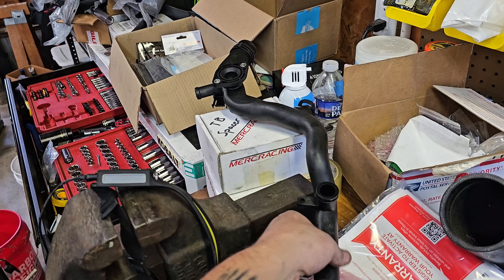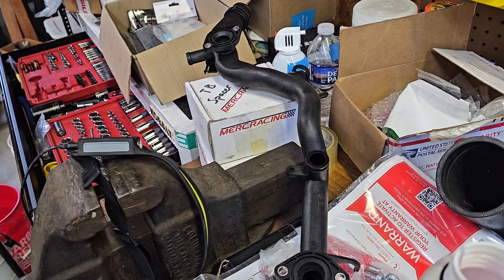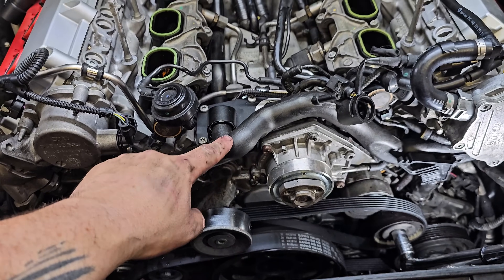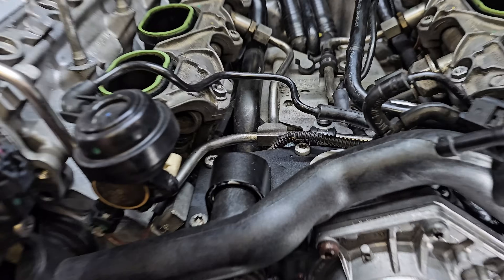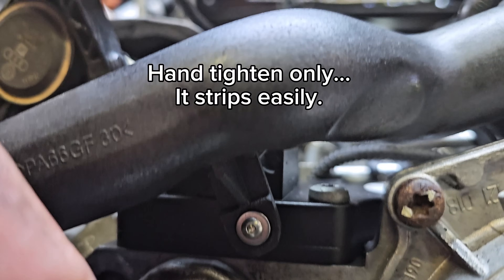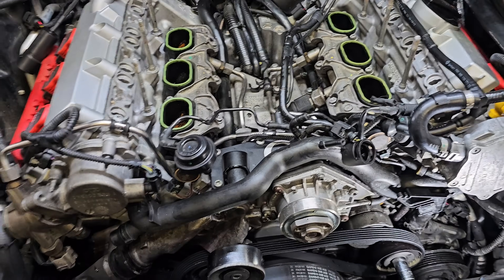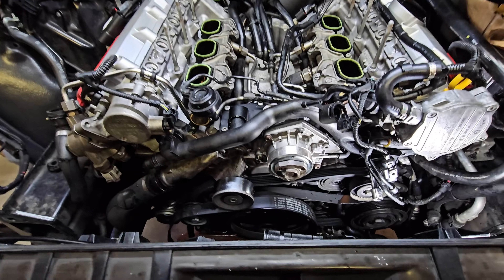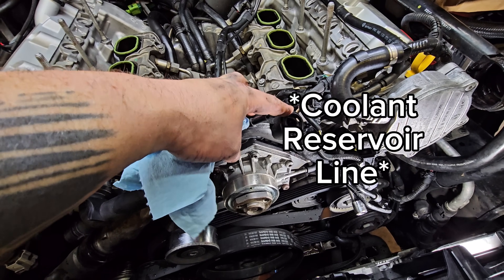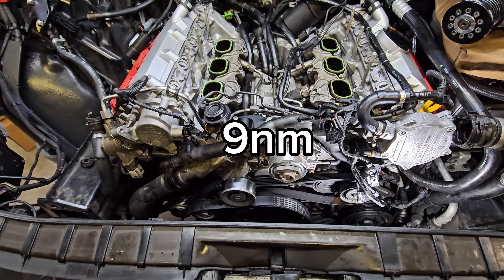I tried to install this replacement pipe during my engine build and it didn't quite fit right, but there's no choice but to give it a go. One hour later — finally got this thing replaced. Once in, you can see it slid right in with no issues. I got the number two Allen in first, then I went and got the other four T30s — two on each side — plugged in. Also connect the vacuum line and coolant temperature sensor. Those T30 bolts on each end get torqued to 9 Newton meters — do not over-torque those either.